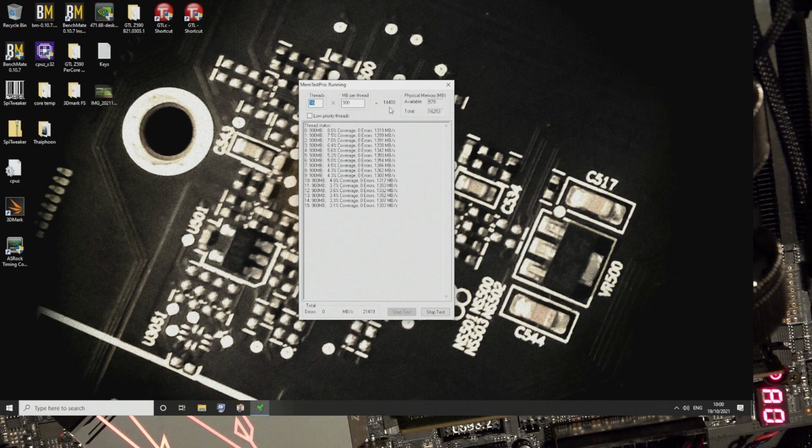Because it is really, really hot. But the thing about LinPack is it just slams the memory controller, and it gives you a really good idea of stability, because even the memory controller is actually temperature sensitive. So you want something that gets the memory controller hot so that you know what worst case scenario CPU loading is going to do to the memory controller stability.